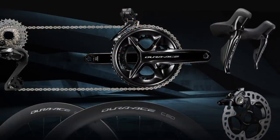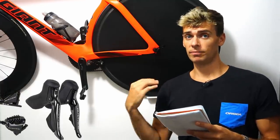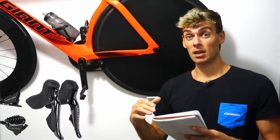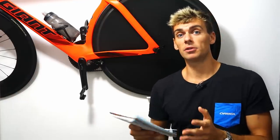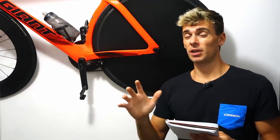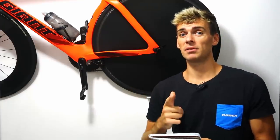What we can see from these new ones is that the hoods are much, much bigger and that's a real shame. We see from SRAM and Campy the hoods are massive, and Shimano in the current generation R8000/9100 the hoods are pretty good. But maybe they've had to sacrifice some of that space — put a larger reservoir in there, a larger master piston to modify the lever ratio, giving the same mechanical advantage and piston force at the caliper but increasing the pad clearance. Even the Dura-Ace hydro ones look bigger and honestly they look ugly. The Ultegra ones are ferociously ugly — they look huge and awful in my opinion.